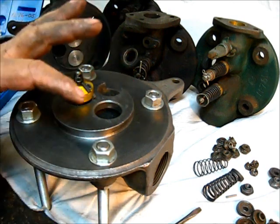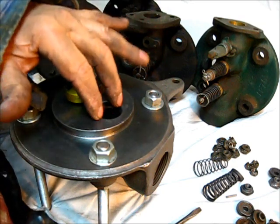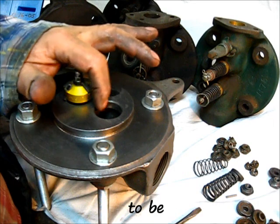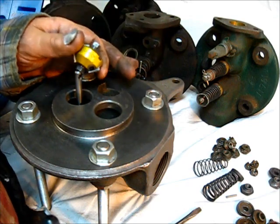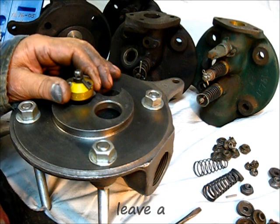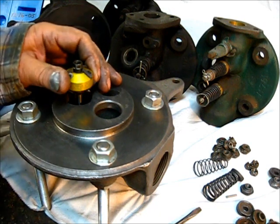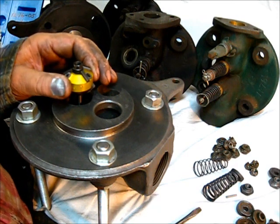I am cutting it dry. Occasionally you will find a seat that has hardened itself because the valve has hammered on it so much that it actually work-hardens the cast iron. In that case you do need some lubricant. If you purchase a set of these cutters, also purchase the cutting fluid — not motor oil. You do not use regular oil as a lubricant on a carbide cutter. It's like using motor oil when honing cylinders — you just don't do that. You need a proper cutting fluid. We're going to cut these dry.